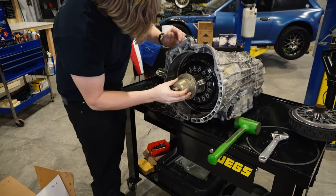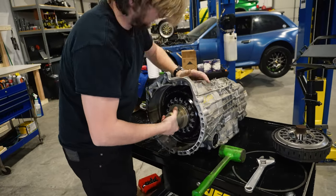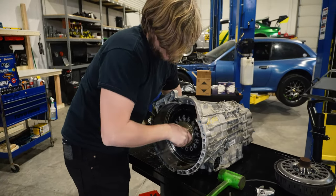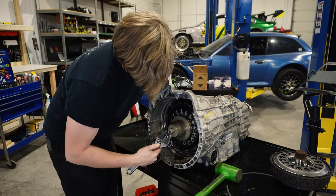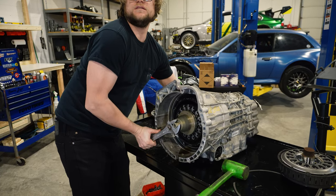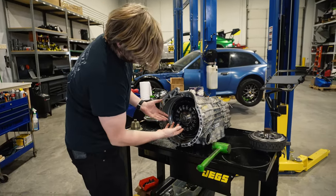Okay, now we've got the tool. Now we can go ahead and lift the park lock. It stops by itself, and then the torque is like 20 newton meters, so literally just give it like a one ooga and you're done. That's sweet — clutch is in.